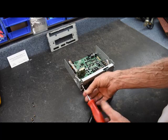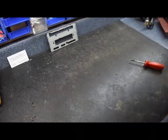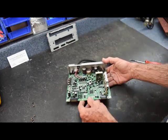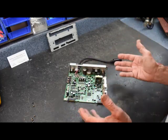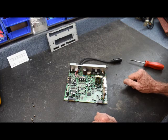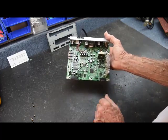You're probably wondering what is causing the hieroglyphics. The board is going to lift right out now with all the screws removed. What we're looking at here is a very common problem. I haven't seen the schematics on this radio — the reason I love this radio is because I found the problem without schematics, and I've seen it enough times to know what the problem is. What we have here is the main motherboard with all the inputs, outputs, and front connectors.